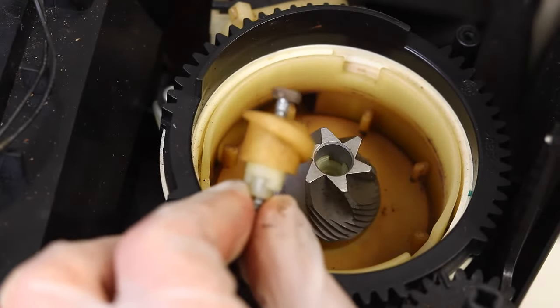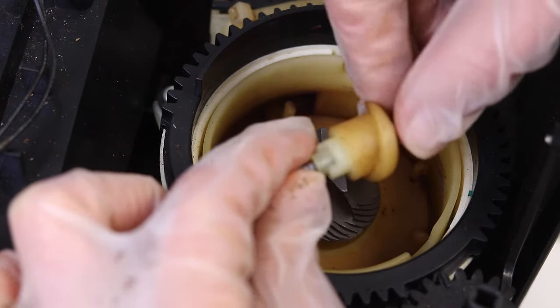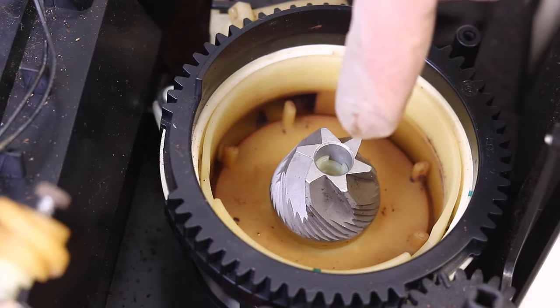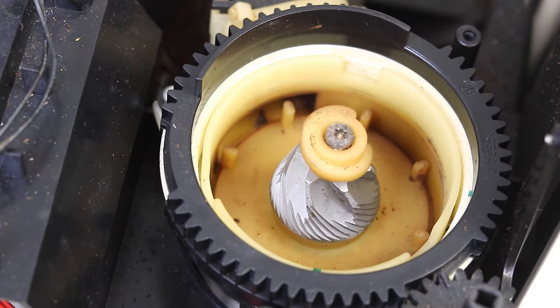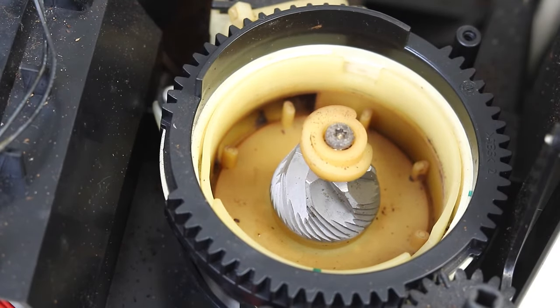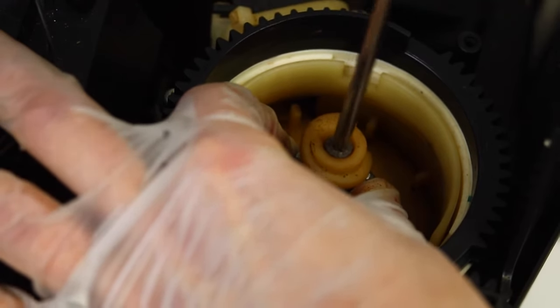Note the bottom pegs under the screw support for the centerpiece — those two pegs need to fit into the corresponding holes on the bottom burr, which you should be able to see in the video. Replace the center screw and support, focusing on the two pegs aligning properly. Using considerable force and holding down the center bottom burr, use your T20 screwdriver to screw down the T20 screw.